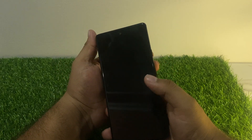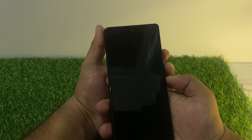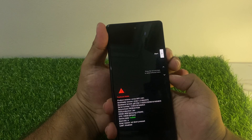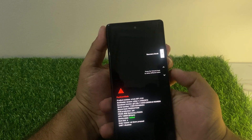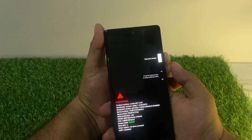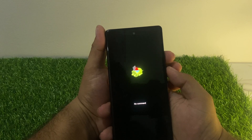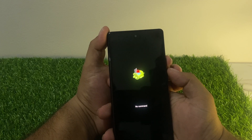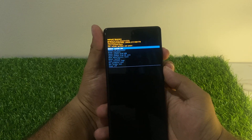You can see the device is shutting down. Press the volume down button and power button at the same time to go to recovery mode, then press the power button. Press volume up button and power button together — you can see it appears on screen.